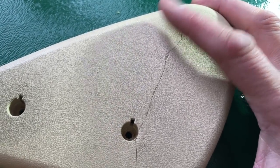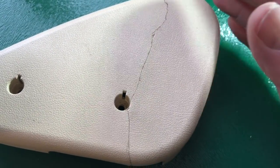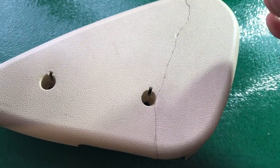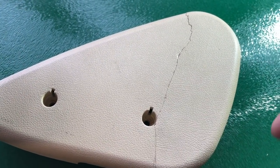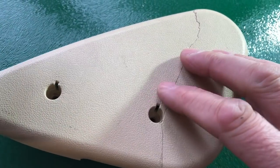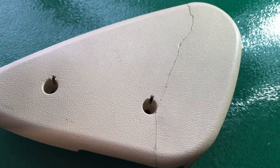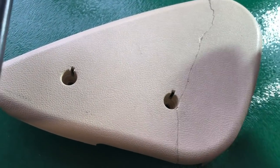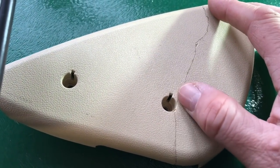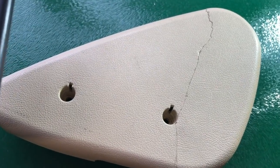Plastics fall into two categories: thermoplastics, like I've just described, and thermosets. Thermosets can be moulded once, and then if you try to do it again by heating up, they will essentially char or burn. They tend to be the stiffer plastics. Interior trim does tend to be fine. Under the bonnet you might find some of the plastics are thermosets, because obviously we don't want them to reshape because they got warm.